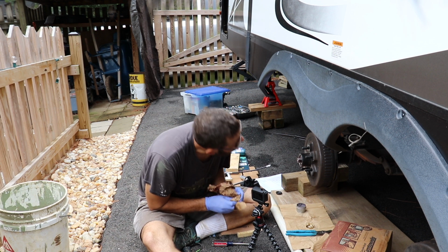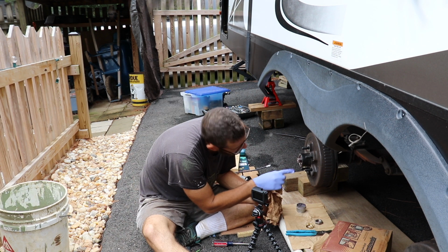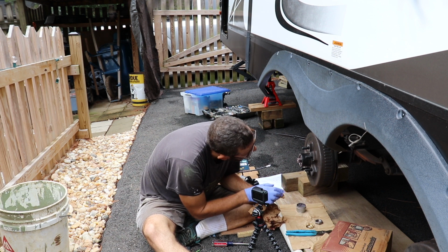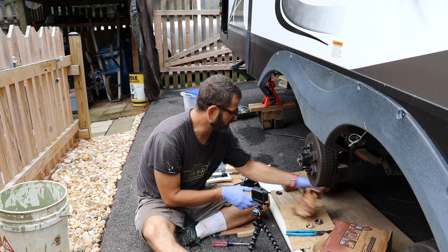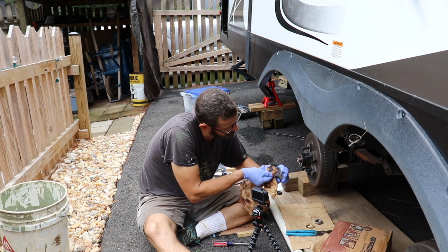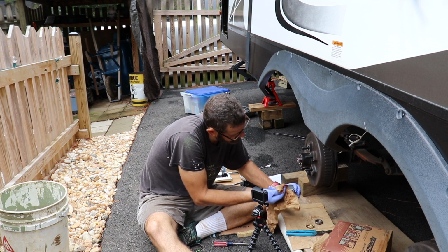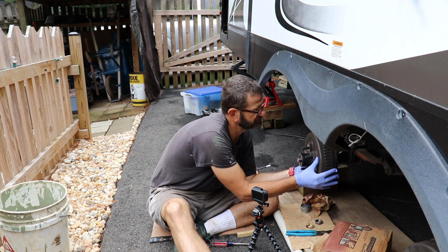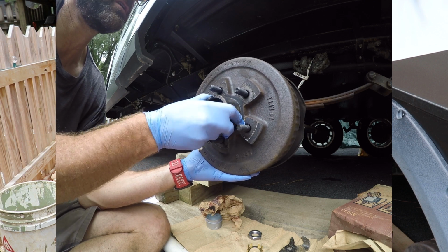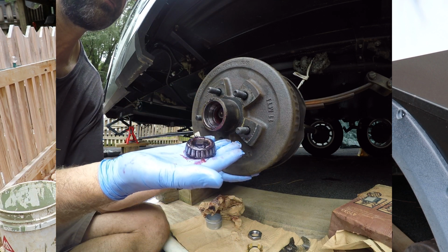So this should be the bearing right here, the outside bearing, and to get it off, I'm supposed to pull the whole hub off. Pull the drum off, so yep, it pulls right off, and you can see the bearing pops out,